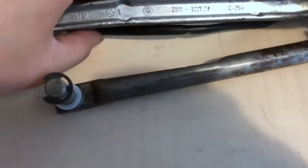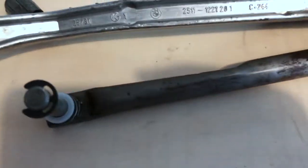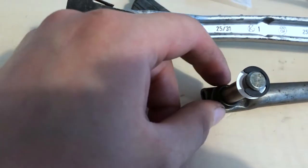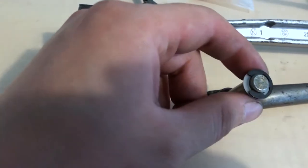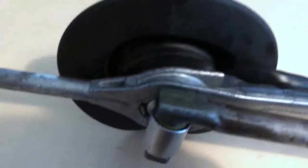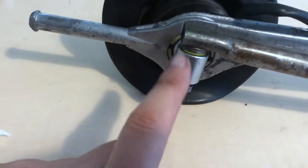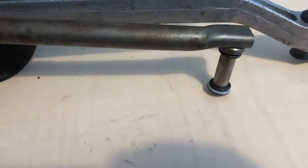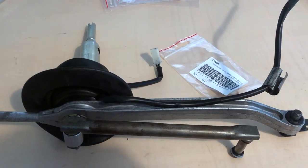We've finally managed to assemble everything — the rubber boot, the wire, and the plastic clip that holds the wire on the other side. Right now I cannot install the foam pad as it goes on the selector rod arm, but I managed to put in the washers, O-rings, and the circlip. The two nylon washers are in and the clip moves nice and smooth without any play. This is almost ready to go on the car.